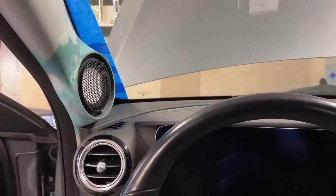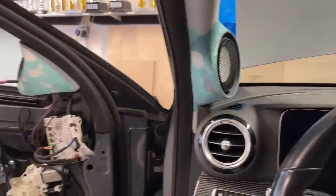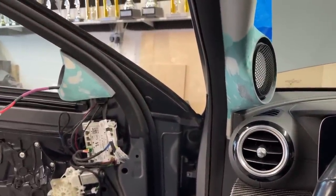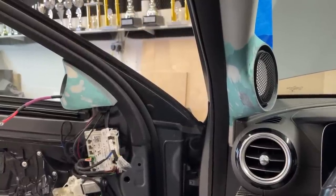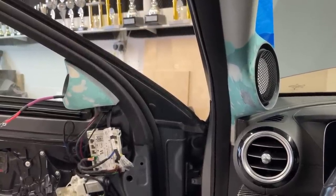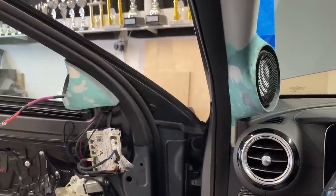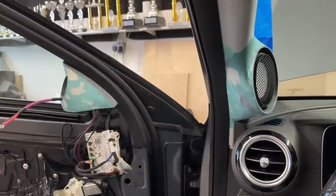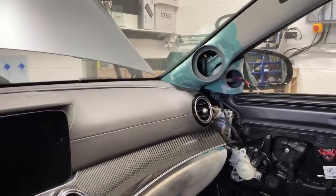We will have a very different finish. We will actually hide all the speakers for many reasons. In the sail panel, the Accuton, it's one of those things that with ceramic drivers, once you have tweeters in the sail panels, you want to think about rain as well. When you open the door in a big rain, the rain is going to drop onto the cone. With the white ceramic, it's okay. It shouldn't be a problem. But if you happen to have the graphite finish Accuton, then that would leave a mark on the cone. We don't have the graphites, we have the whites.